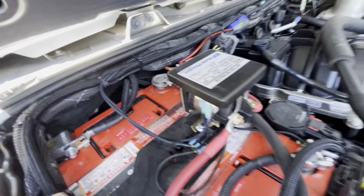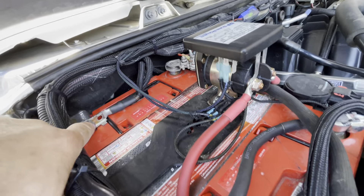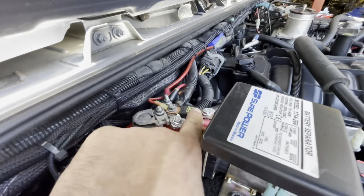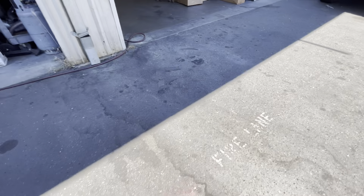The other one will go to the ground. We grounded it on the chassis, but you could do it to the battery. One's ground, one's hot. This is the fuse we use — 100 amp — and we cut the plug off.